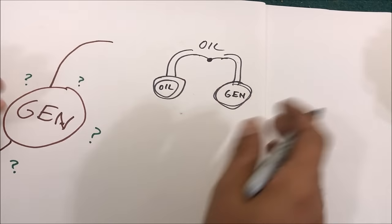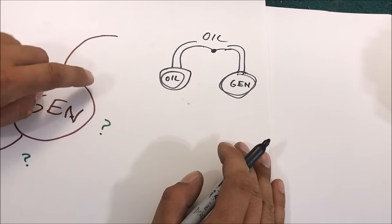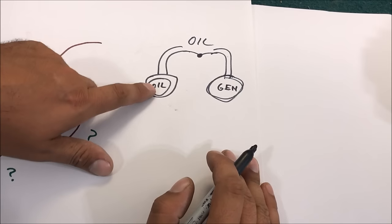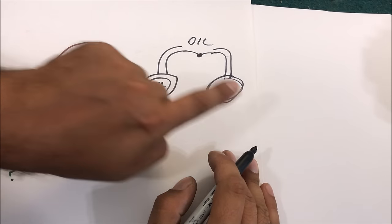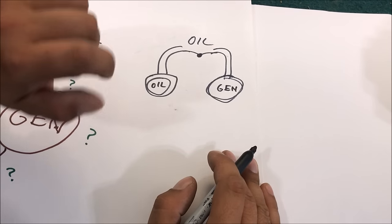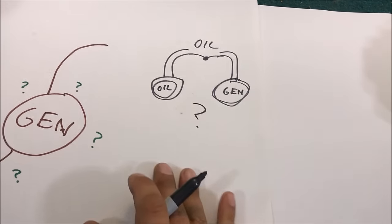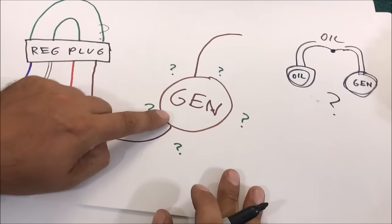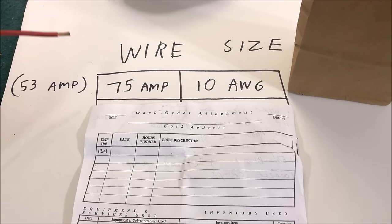If the light is seemingly working, it's wired up to something else - something's screwed up in your car. There's no reason for it to work. The point is: if you're running a one-wire alternator, there is nothing connected to that light. Your gen light is not going to work with the one-wire. The only thing I can think of if your light is coming on is that possibly you have your temp, gen, or oil pressure dummy light switched, because the oil pressure light comes on when you start the car and shuts off as soon as it gets pressure.